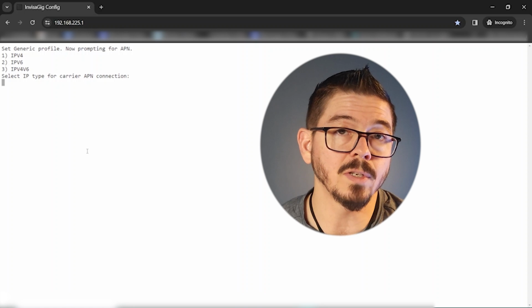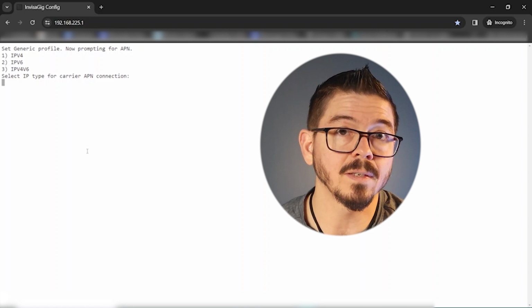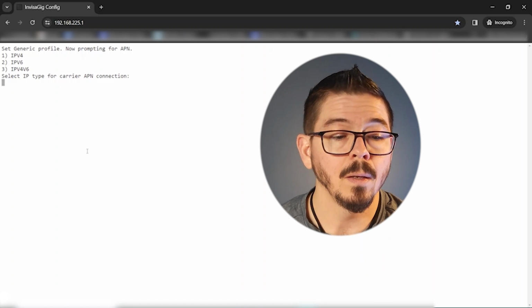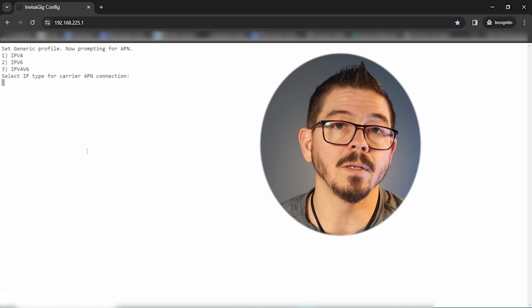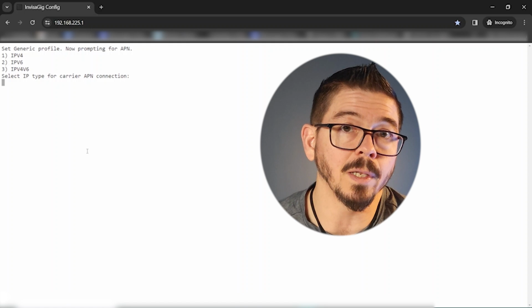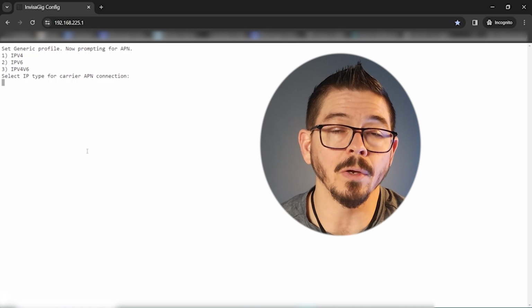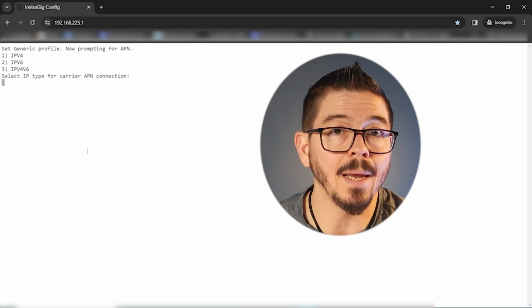That's called dual stack light, many other things as well, but it's a dual stack IPv4, IPv6 selection that allows your modem to use both depending on how the carrier applies it to you. Whenever you need the IPv4 only or IPv6 only is typically under certain special scenarios. If you're selecting those, you probably know that you need it, and you don't really need much explanation. For everyone else, IPv4 addresses are not statically publicly routable addresses on cellular devices unless you have specifically added it to your account, a paid option.